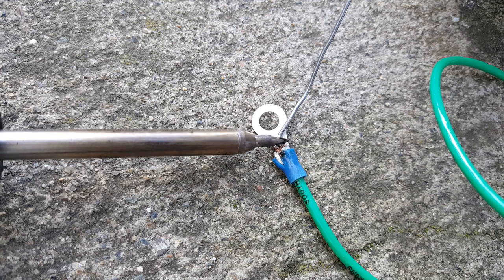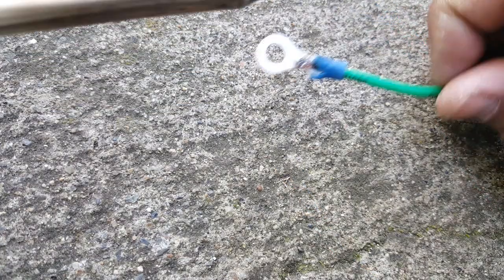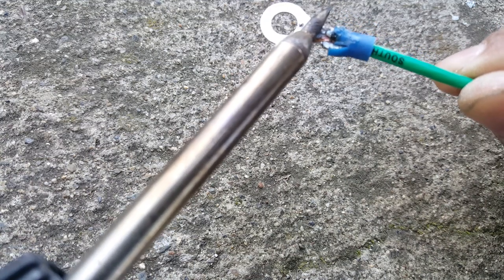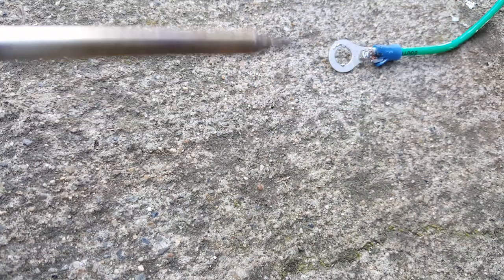It helps if you have a good soldering iron — heat it a little bit more. This one is just okay. I'm going to fix the solder work so I can hold it better. You can see I'm bringing the solder the other way, wanting to bring it to the wire more. Cold solder might make it worse or won't have good contact. I was burning the plastic a little bit.